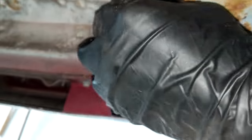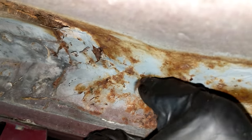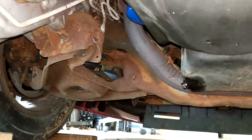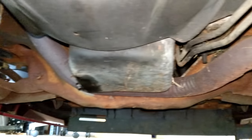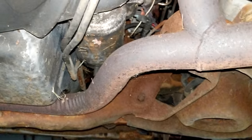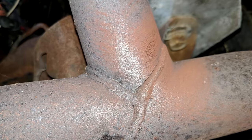Overall, the body of the car is in good shape. This is pretty much the worst spot of rust on the underside; most of it is pretty clean. I'd really like to clean this up and apply some rust converter in the near future. There's the usual surface rust on the front end, but nothing too bad. Even the Y-pipe isn't too rusty, but when looking at it closely, we notice this little line which could be a crack. It's right at the edge of the weld and looks like it probably is some kind of crack.